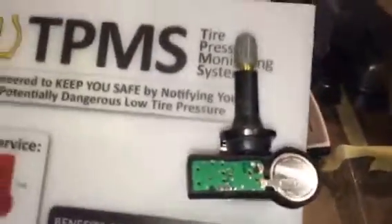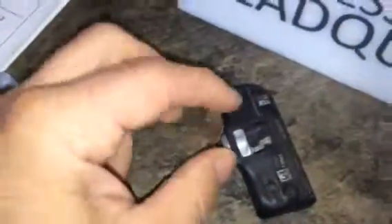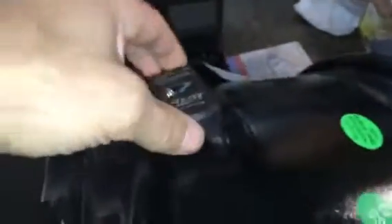You can upgrade this style to the rubber stem I showed you, and they're the same price — so in New York State I'd recommend people do that. These new sensors we actually use are programmed to be very resilient. Other causes of failure include screws that can't be removed and break, sections that crack off the sensor, and most commonly, people not knowing how to dismount the tire off the rim because of the sensor's location. If you're not careful taking the tire off the rim, it puts pressure on the sensor, cracks it, and causes it to go bad.